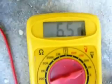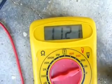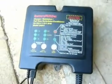What I've got here are two lawnmower batteries. If you look at this one, the voltage is around 11 volts, and this battery will not hold a charge — it won't crank the lawnmower anymore. And then on this other battery, it's showing almost three and a half volts, and this battery will not even take a charge. When I put it on the battery charger, it just gives me a fault and will not charge at all. So I have borrowed a unit that is supposed to desulfate and recondition the batteries.